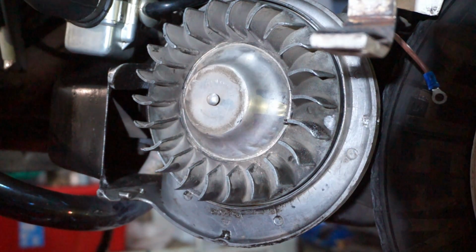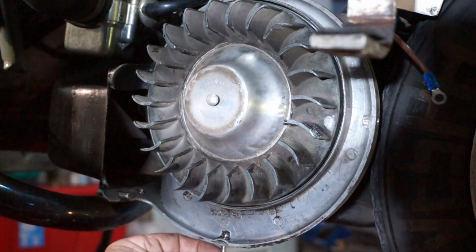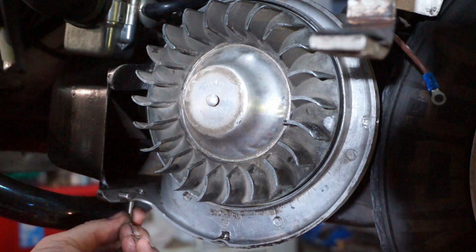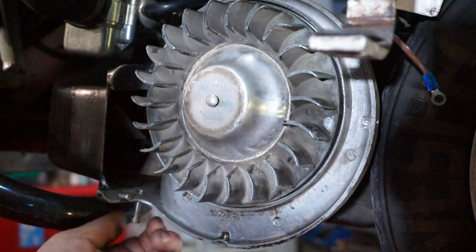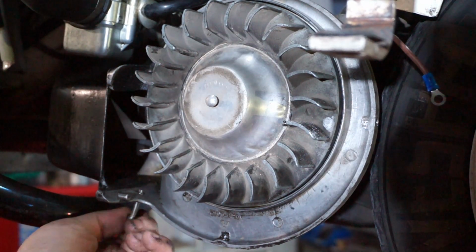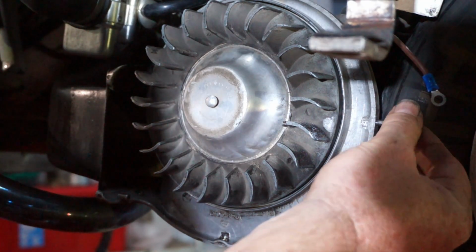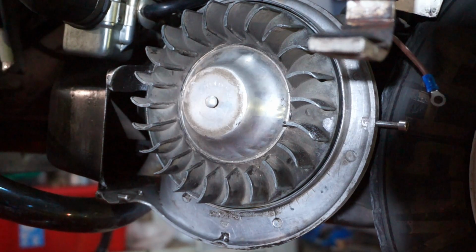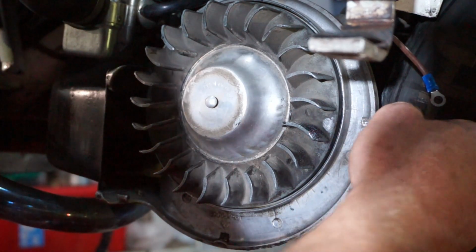Okay, right, we've got a little bit further. I thought I might as well have a go at repairing some of his threads. We've managed to get some helicoils in. We've repaired that one. We've repaired this one as well. So it's got a helicoil in there, and one on the back here. So now he's got pretty well all back to 5 mil. So the 3 damaged ones that were down here have all been fixed.